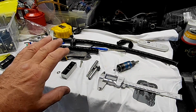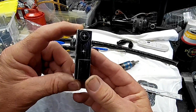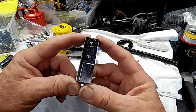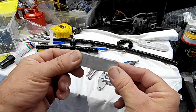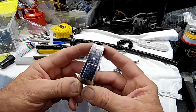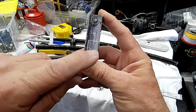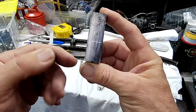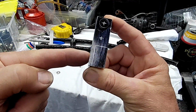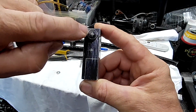But we'll see. And what I'm currently doing on the bench, folks, is I'm about to start making up this bracket that's going to be used to hold those lines in position off the chassis rail there where I showed you. So you can see this is just a bit of 20x20 aluminium. It's actually been cut off the side of something else that I've had, but it's about 20 by 18 or something like that. And this notch here is going to be notched over the chassis rail, and then there's going to be a bolt hole drilled through here, and that's going to go into that existing threaded hole that's there. And then there's going to be 2 spots here for the hoses to run through, so we'll drill that.